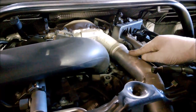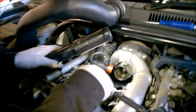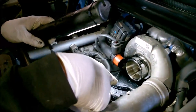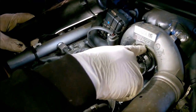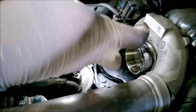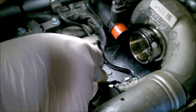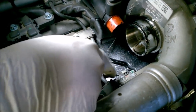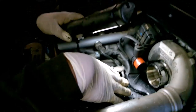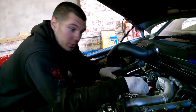What I'm going to do is take this pipe off so you can see it. I've removed this pipe now. Usually you're going to see a lot of oil and remnants on top of your swirl pot motor, and this is normally why it's failed. The turbo seals on the inlet of the turbo and on this little crankcase vent leak oil basically on top of the swirl pot motor. The ingress of oil then corrupts the circuit board on the top of the swirl pot motor, and then you will get intermittent loss of power and that warning light.